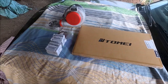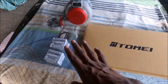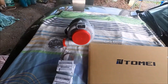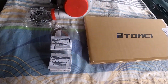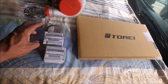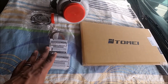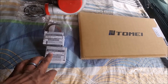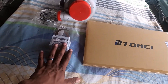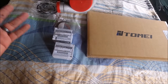We have a pile of goodies right here. We have the motor over here but we'll get to that in a minute. I began disassembling that motor and when I was about to reuse the crank and main bearings, I found out that the bearings had a bit of wear to them. So I went ahead and bought some bearings locally from the Nissan dealership - some genuine connecting rod and main bearings.